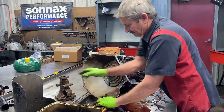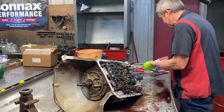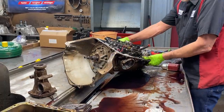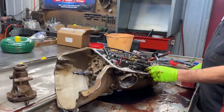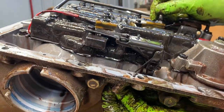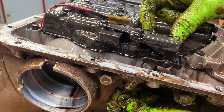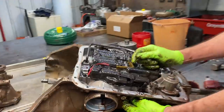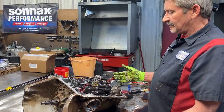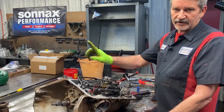This thing's really nasty. And we have our detent linkage here. When you push on the gas pedal, you're pushing your detent valve inward. Let off the gas, it comes back. So when you're going to hit passing gear, you push it down and it pushes this valve all the way back. Let off the gas, it comes back — that's called TV pressure. So anytime you're sitting there idling in park and you've got a gauge on it, if you grab that TV cable up on the carburetor and pull on it, you're going to see pressure rise on the gauge. So you always want to hook that up properly.